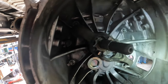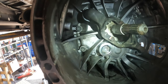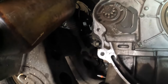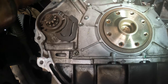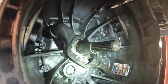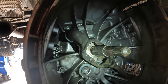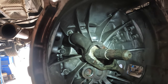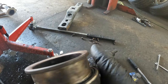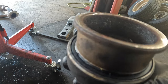We washed the inside of this out — you can see there's still some residual down in there, it's just hard to get out. We did wash it out with brake cleaner and it looks a lot better. We even sprayed the engine back here down. We still have to pop this rear main seal out — you can see where it's leaking down on the bottom. I'll use the screw trick — screw it in and pull it out with a screwdriver — then tap the new one back in. I'm going to put the old throw out bearing in here and — you can hear that — this sucker is worn out.